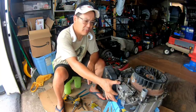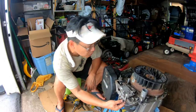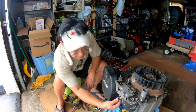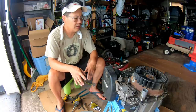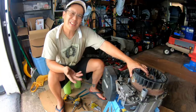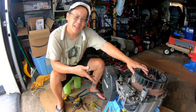I'm a little confused about how the throttle linkage goes. There are two linkages — one for the governor, and there's also a spring that goes on another thing. I don't remember exactly. When I put the flywheel back on again, it was missing the woodruff key — there's no key in the keyway, so I had to put a key in there. Either I lost it when I took it off, or it didn't have it.